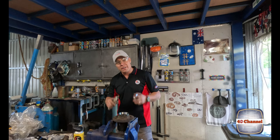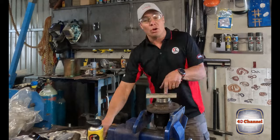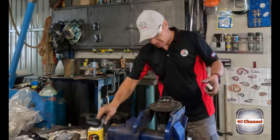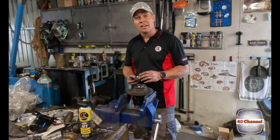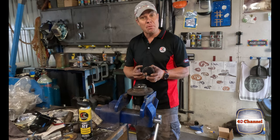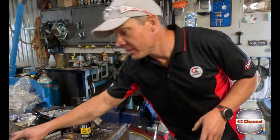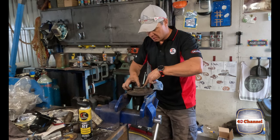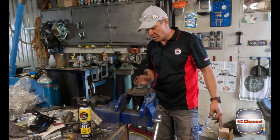All right, the backside bearing is a little bit easier. You slip it in here. Then pop out the old one and we're ready to go. Make sure you're putting your bearing races in the correct way. So these are a taper bearing, so it's obviously facing up, so the bearing can drop straight into it. A pre-greased bearing will drop straight into our hub. Now we're ready to put the seal over the top.